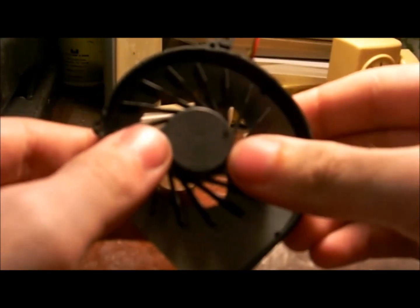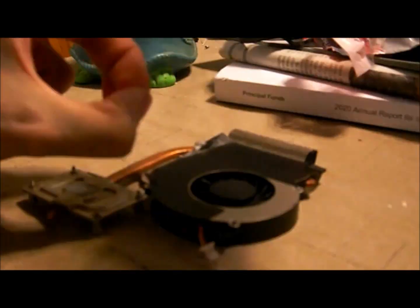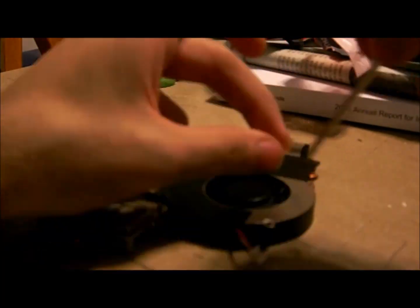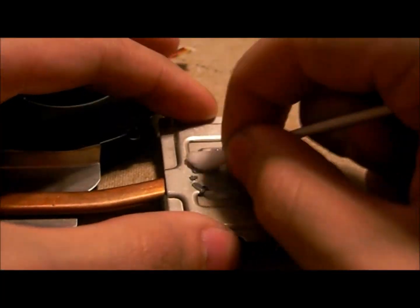So I took it out of the box and got the laptop prepared to be repaired. I got rid of that old ratty fan and put in the new one. I also replaced the dried up heatsink compound goo that was in between the CPU and cooling system. It was all crusty, so I was thoroughly convinced that it wouldn't transfer heat very well. So I dipped a Q-tip in some rubbing alcohol and scrubbed that off of both the CPU and the cooling system.